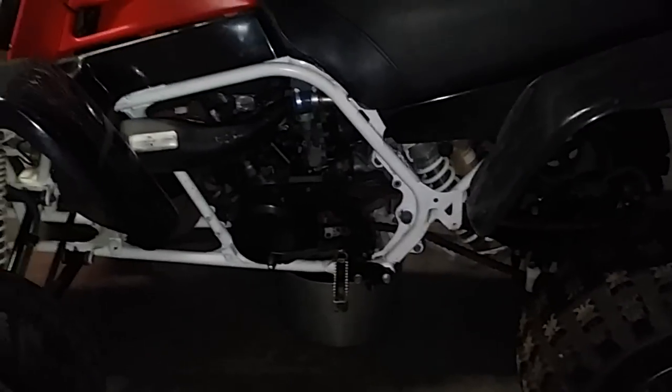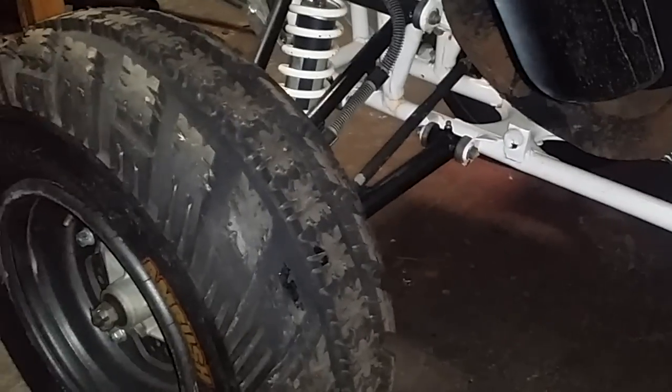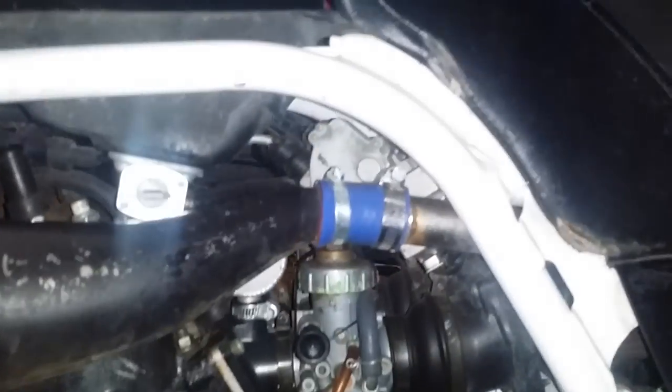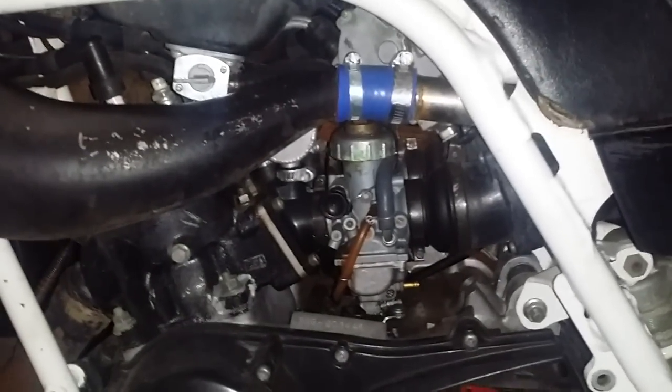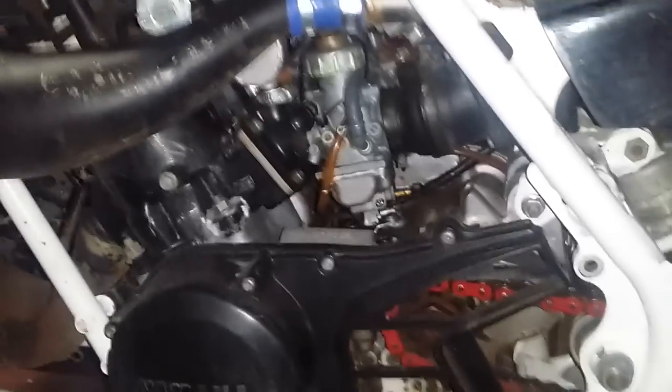The story with this one is he picked it up — I think he paid like 1200 to 1500 bucks, he got a good deal on it. It's got a powder coated frame, pipes on it, new tires all the way around, which is kind of strange because tires are usually the first thing we do. From what I can see it's got aftermarket coil caps on it, so it may have had ignition troubles at some point and they put some eBay coils on it.